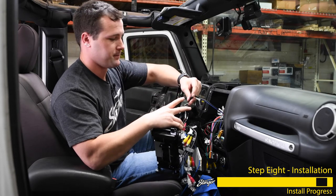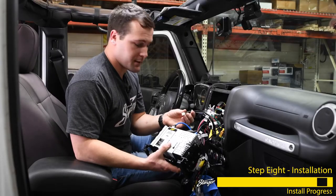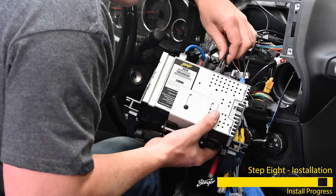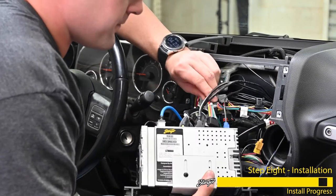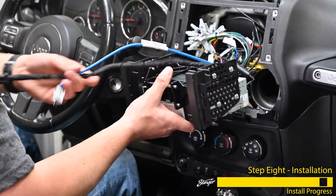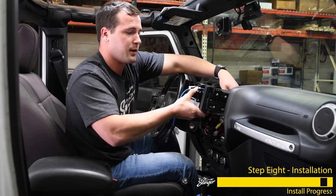SWI stands for steering wheel control interface. Plug in your GPS antenna, plug in your 10-pin camera harness, your new USB ports, and now the main radio power connector. We need to make sure that the black plastic part of the radio brain is going to be facing up and ensure that these two cords are coming to the front to connect to your display once we mount it. Now tuck the remaining harnesses all to the side in the dash to make way for the radio to slide into place.